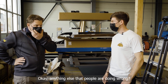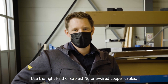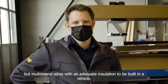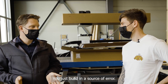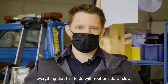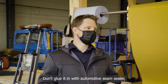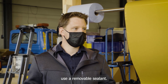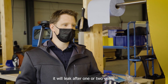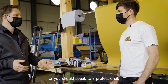Another common mistake: use the right cables — not single-strand copper wire but stranded cable, properly insulated for use in a vehicle; otherwise you're building in a fault source. For any roof windows or side windows, take your time and read the instructions. Don't seal them with body filler — use a removable, dabbing sealant. If you glue it in permanently, it's guaranteed to leak within a year or two.